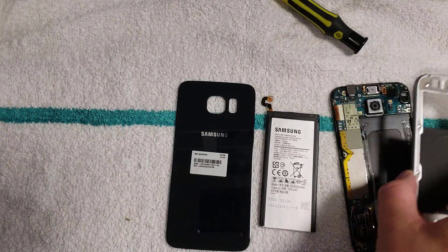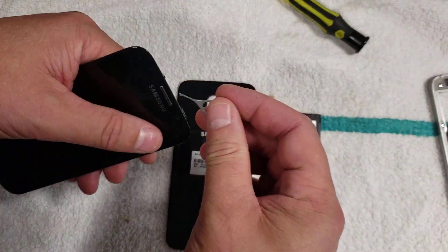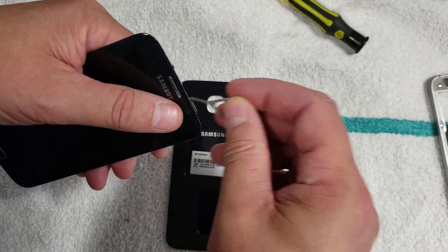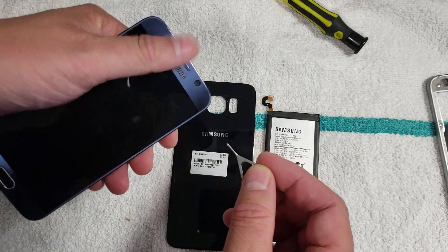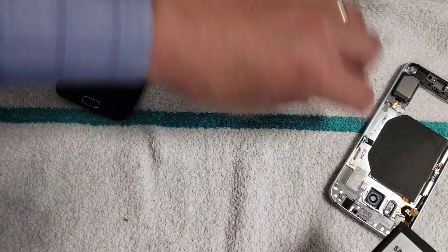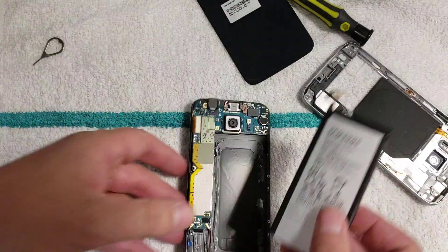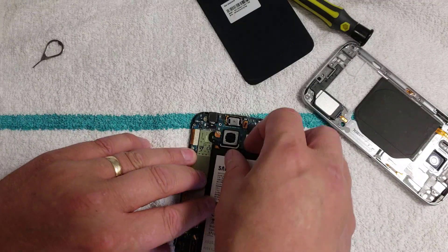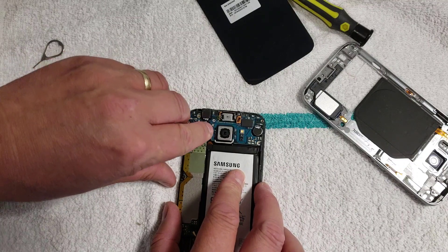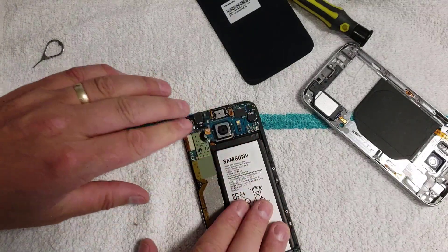Okay, so let's put this back together, and it is a little different than you might expect. If you did what I did, I slid the speaker out, and what I needed to use was a little pin to pry underneath the screen and pop that back in. So that's back in there now — nice and happy. Second thing is, you just sort of rebuild it in reverse order. So pop the battery in. This clip I have to move a little bit north of where it wants to be, apparently, to get it to clip. And boom — there it is. I can tell it's happy. That seems to fit in nice and clipped in nicely.